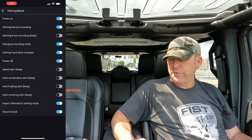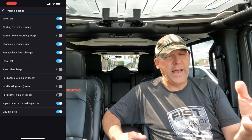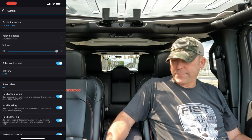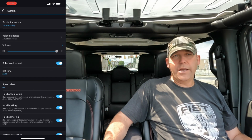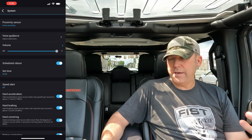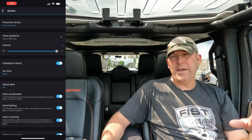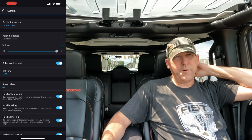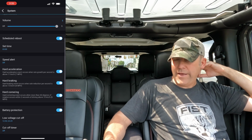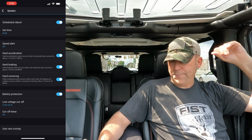Voice guidance volume, we're turning that all the way up. Click on voice. We can do power on, starting, normal, recording. All these different things will be announced by your dash cam. You can choose which ones you want to announce and which you don't. Back out of that. Scheduled reboot, leave that alone. You want this camera to reboot, and it helps the camera. It's also good for keeping the SD card from locking up. Keep that on a scheduled reboot, for like formatting and stuff. I would leave that alone. You could schedule the time. Speed alerts, you could have all that. Hard acceleration, hard braking, low voltage cutoff timer, user text overlay.